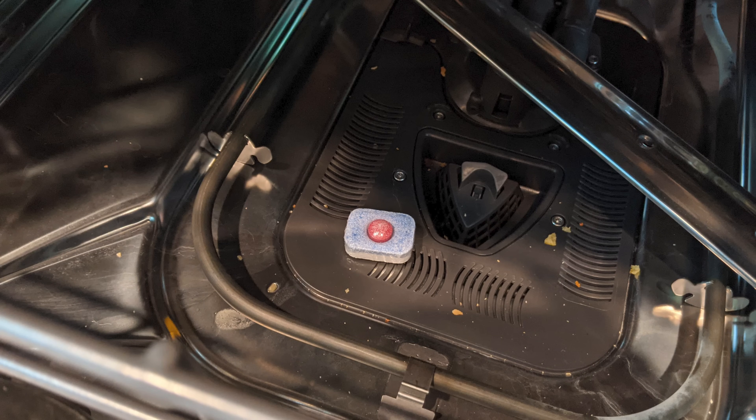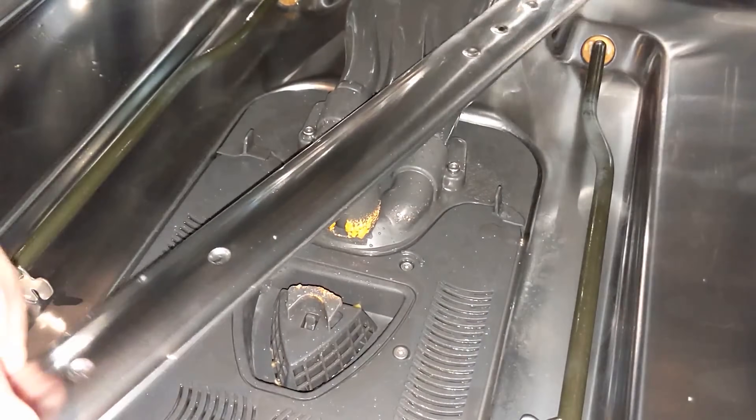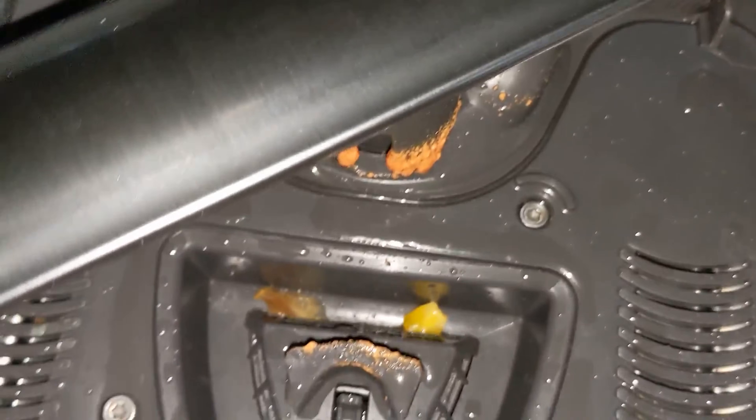They've designed the programming to account for that — if it discovers there's hardly any stuff in there, it's just going to skip the pre-wash drain, open the detergent dispenser and continue. That's probably why the second time I ran the test and opened the door, it was hot in there, because it recognized it was going to skip the pre-wash and move on to the main wash. So the reason I didn't record this until later is because I realized: what if it's able to tell that there is detergent in the water? This didn't make a lot of sense to me because it still opened the detergent dispenser door, but I wanted to test one more time.